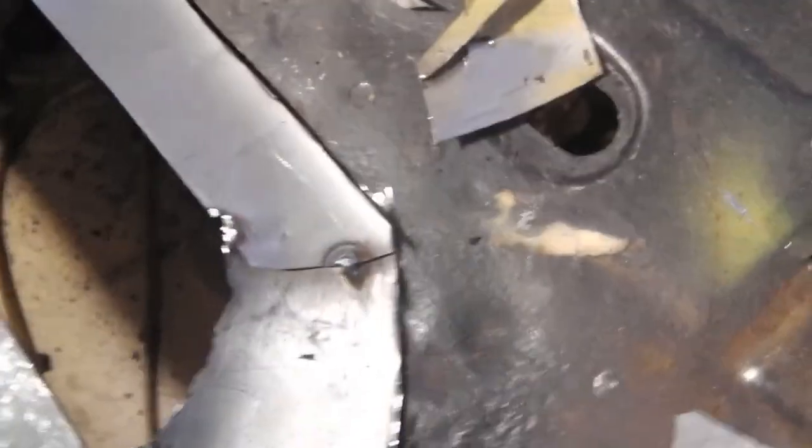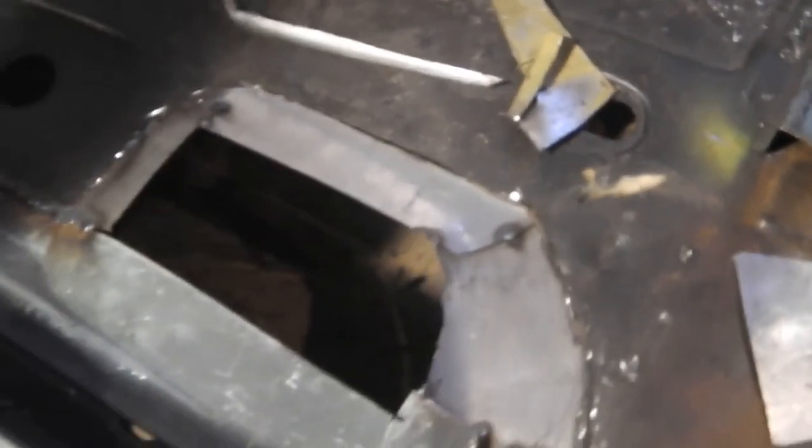I've now cut it out so that we can get the butt weld in. Just like put the angle grinder through. This skin was built over that one, and then you drop the old skin out, leaving the fresh skin in so we can seam weld around there. Now all needs a topping plate. Finish off all those welds, you got yourself a nice repair piece of floor.